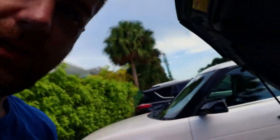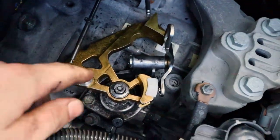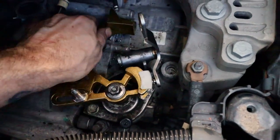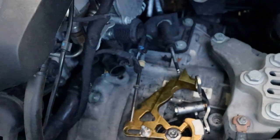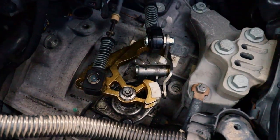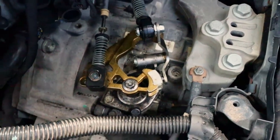I have the new short shifter in. Got it greased up with the side-to-side part as well — you can tell here. I put it all the way to the 40% reduction, got it in nice and greased up, looking good. Now I just got to put the shifter bushings back in, and I also got to put the piece in here too to fit for that. But it's officially in. Everything went smoothly except for getting the original shifter off — that was a pain in the ass.